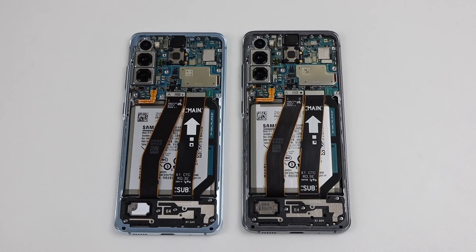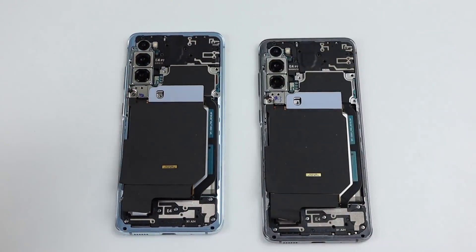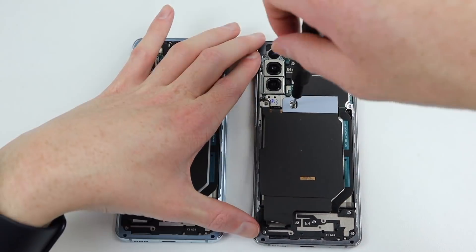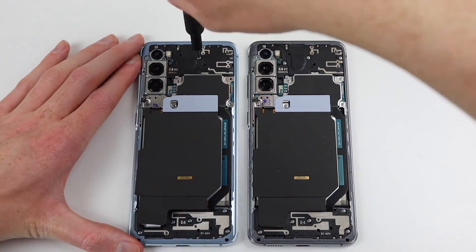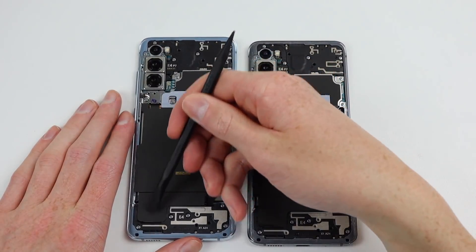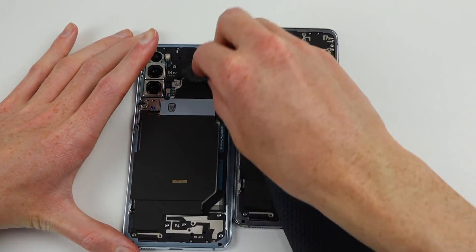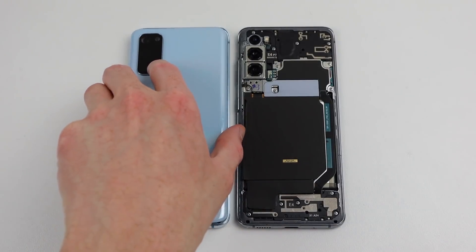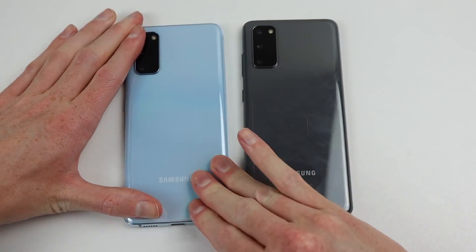A quick clean is given before I start screwing in the motherboard, antenna, and wireless charging modules for both phones. With all screws in this phone using the Phillips head, repairs only require the one screwdriver. And with the screws for the wireless charging coil, antenna, and speaker assembly all being the same length, it's easy to keep screws organised. With all screws reinstalled, I'll ensure the wireless charging coil is adhered back into position. I'll clean off the cameras and the inside of the phone with a microfibre cloth before getting the back panel reinstalled. I would advise applying new adhesive before reattaching the back panel; as I've had to order some internationally and it hasn't arrived yet, I will just temporarily stick the back on with the original adhesive and come back at a later date.